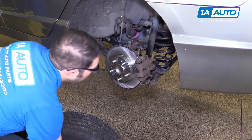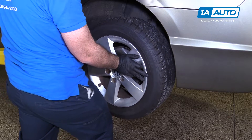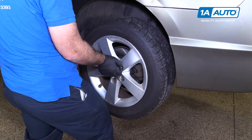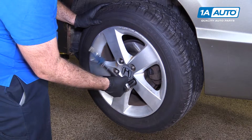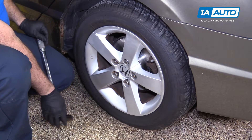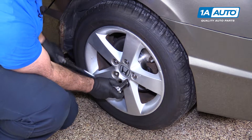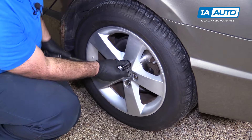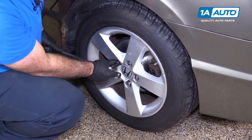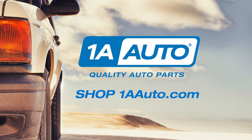Put the wheel back on the car. While the lugs are caught, get them by hand first. We'll torque them with the vehicle weight on it when it's on the ground — really just need to bring them down until they're seated. The lug nut torque is 79.6 foot-pounds, so we're going to do it to 80. Do this in a cross pattern. Thanks for watching. Visit us at 1AAuto.com for quality auto parts, fast and free shipping, and the best customer service in the industry.